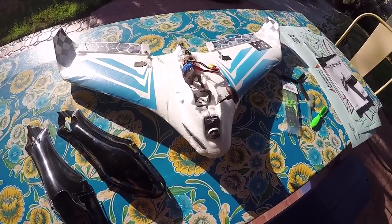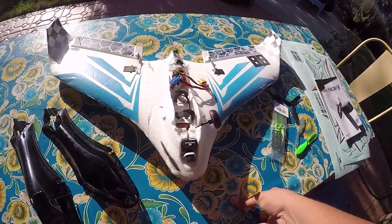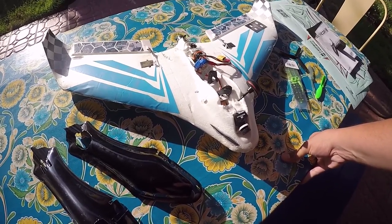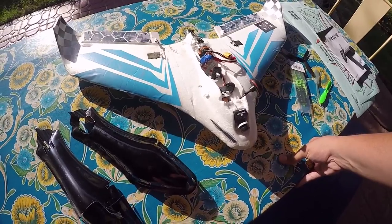My only major gripe is that in stock form, it's all but unusable because of the noise generated by the motor speed controller combo. Kind of debilitating lines in the video. As you throttle up, it becomes almost impossible to see, much worse than any static or anything.